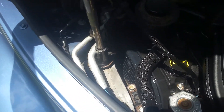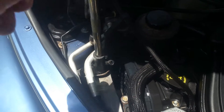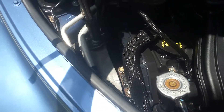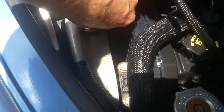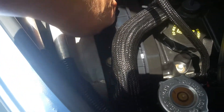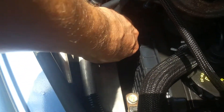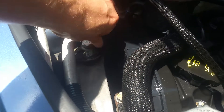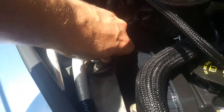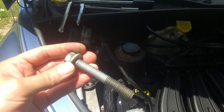It'll be pretty tight — you may need a breaker bar to get this loose. We're just going to completely remove this. This mount here in particular, it's hard to see the condition of it because of where it's located, and you can almost bet that if you've got over 100,000 miles that this is in bad shape. I'm going to go ahead and get this bolt out and we'll get on those other two. Let's go ahead and wiggle this bolt out. I've got it loose, but it's still hanging on to something there. That's what that bolt looks like.